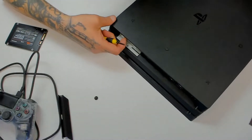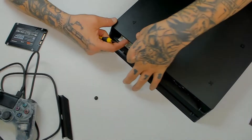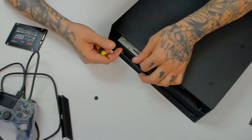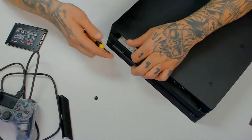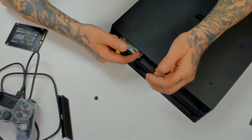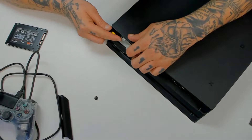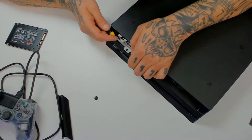There are two little hooks right here on the hard drive casing that you pull to pull the hard drive out. If you've never pulled your hard drive out, it's going to be really stiff and hard to do. Some people stick a screwdriver in it like this and pry it out, or you can take a string and wrap it around both of them and pull it out together. Since I've already had mine out before, I'm just going to use a screwdriver, and it pops out really easy.